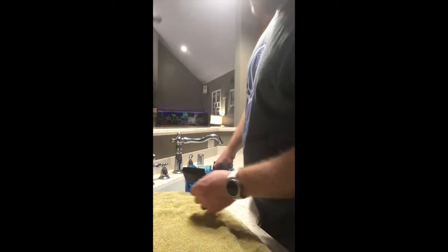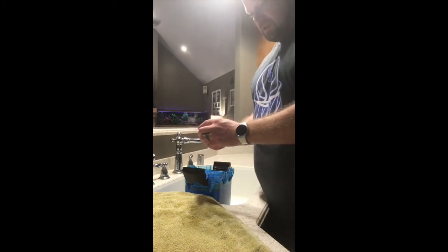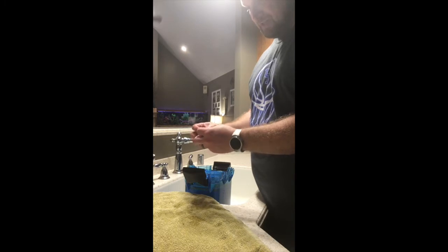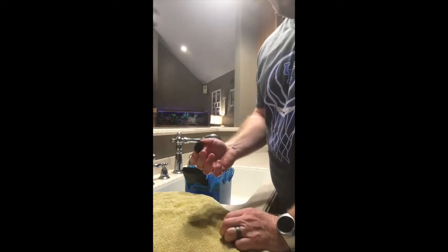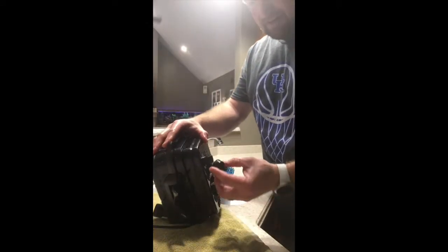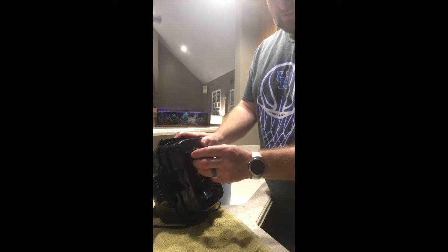There was one O-ring inside here I was going to tell you about. It's the O-ring that goes around inside the pump, and you'll see it's got the same stuff on it. When I got this out of the box, this one here, the O-ring, was not installed properly, and I was kind of worried about it, but it was cramped over a little bit, so I cleaned it up, straightened it, put it on in the proper place, and it's actually gone back to the right shape it should. It looks good. Now this right here, it goes on this, but it actually goes inside this top Cascade filter, but that's where that actually sits, and it was not in there properly.